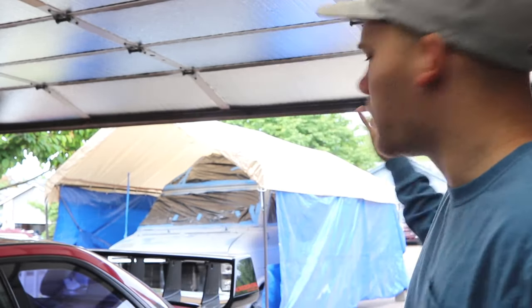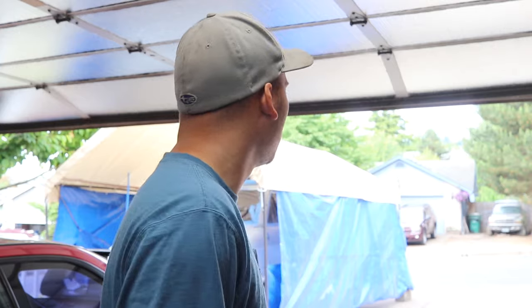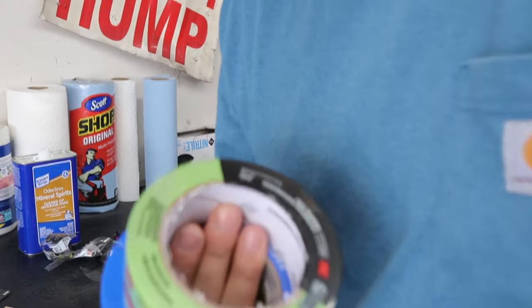Okay, so it's been now 72 hours. It's time to take the walls down on the car cover and double and triple check my masking job. Start masking off the lines for my white stripe, and then sand and scuff the overspray, and then spray and hope that the rain stays away. The forecast keeps changing, like, hour by hour. Today it's supposed to be just cloudy and dry, and then I'm just gonna bundle up the car cover as much as I can to protect it from the rain, because it's supposed to rain for about the next 5 days.